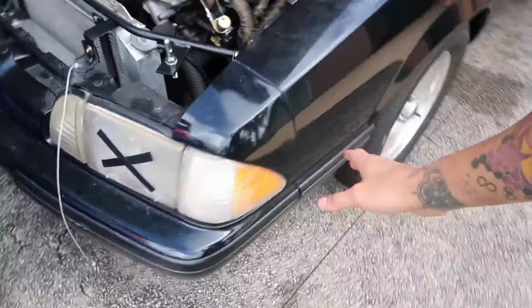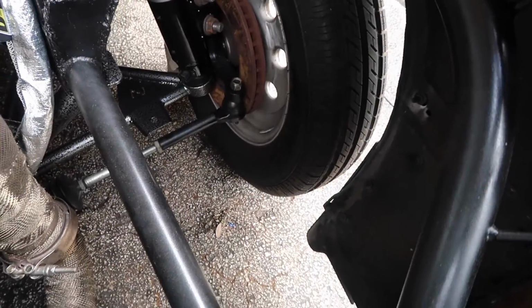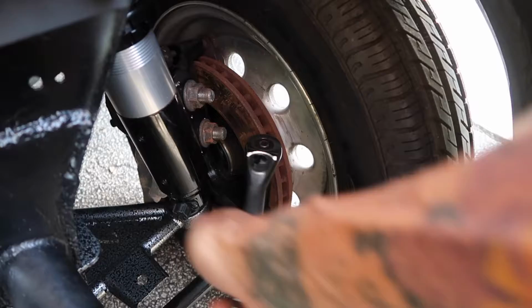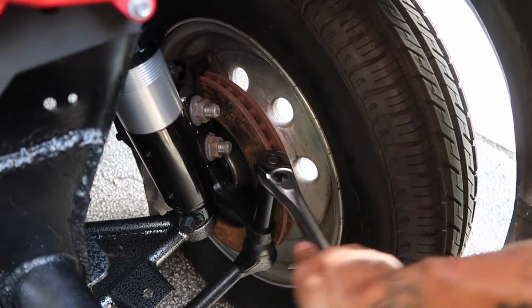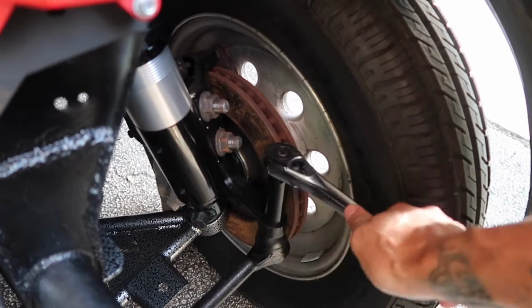that difference. So I went ahead and made my adjustments to the wheels, and then I adjusted the tie rods accordingly and got them put back into place. So now all I have to do is get the tie rods tightened down, and then we can move on to getting the new steering column installed on the car. One of the many benefits of having a tube front end is that we can do things like work on our tie rods without having to jack up the car and remove the wheels.